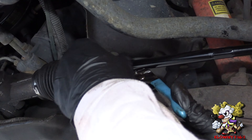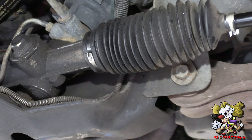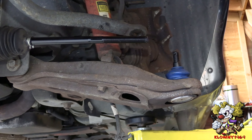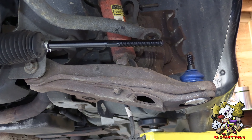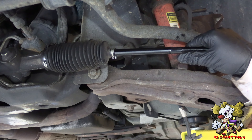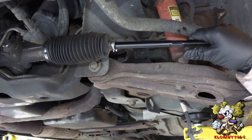And the clip at the end over here. Now put the outer tie rod on — count the number of turns going in and measure the old inner-outer tie rod length against this length. I'm also going to give it a little backyard alignment. I have a link in the description below on how to do that, just to get you ready to go to the shop to get a real alignment.